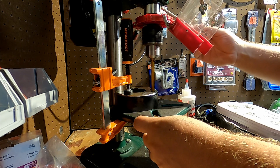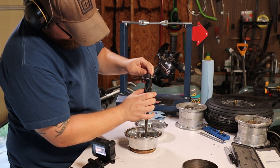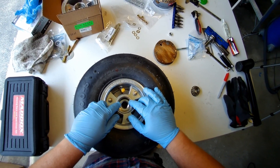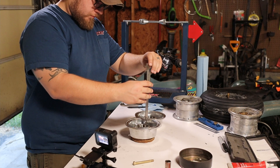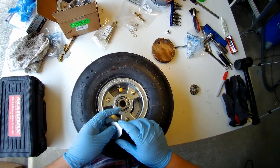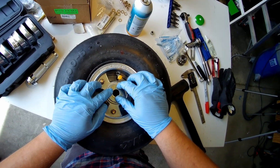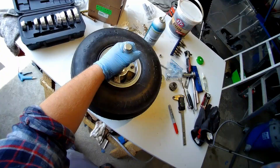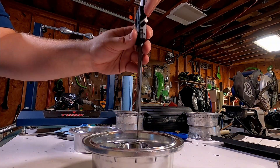Anything being offset here will cause a wobble. It's not in the instruction sheet, but now is a good time to check the bearing races. The Azusa wheels come with new bearings and the race is already pressed in, but not correctly. Use your caliper to make sure the depth of the race is correct and even. You'll know the depth is correct when you place the bearing and washer in and the washer is flush with the axle bore. This helps protect the bearing from the elements. The best way to do this is with a seal driver and press, but a mallet will work too. Just be careful not to strike the wheel, and make small adjustments until it's right.